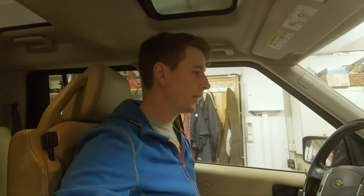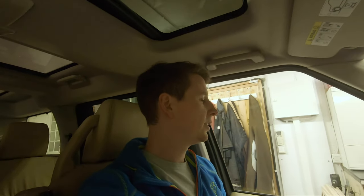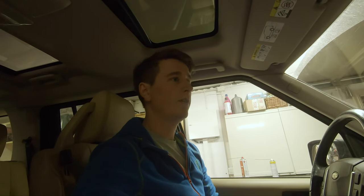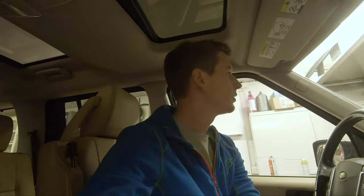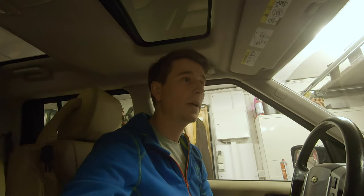Going to raise it all the way up to the top — this will take a while since the air tank isn't filling as fast as it should. I'm going into off-road mode and rolling back and forth so the suspension can level itself out, otherwise the camber will work against the air struts. When your tank isn't working properly you can also get a notification that the air suspension isn't rising fast enough. That could indicate the air tank or compressor is broken, but my compressor is new — it's the AMK one I replaced last year — so it's time for a new tank.